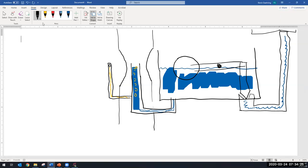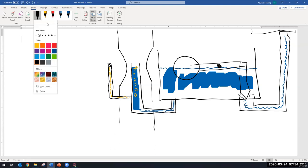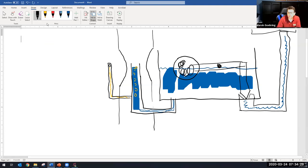Can you explain the main air bleed again real quick? Yep, this is my float. The main air bleed is over here, and we're just going to talk about what happens when it's running, because I think that'll be easier. So without the main air bleed, the carburetor works. The Venturi works — it's pulling air through the Venturi, creates a low pressure, and it's going to suck the fuel out.